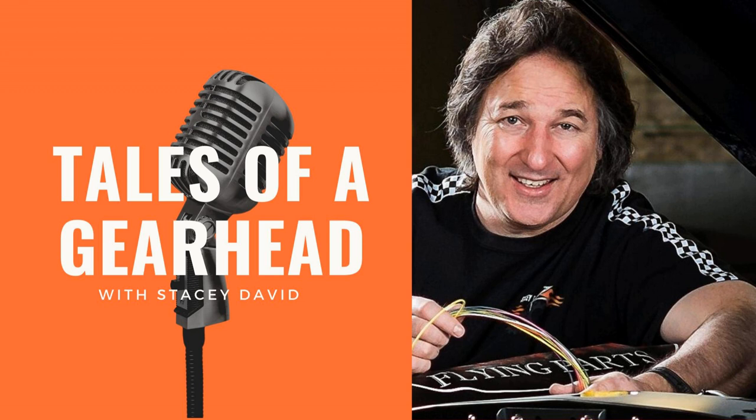Larry, you've got some simple solutions here. This is not an uncommon problem, and it's why I always recommend when you start tearing into a new vehicle — especially with weather stripping or old components — that you keep your old pieces and measure them up side by side against the new replacement pieces. A lot of times they'll be just a hair thicker, and a 32nd of an inch here and an eighth of an inch there all adds up.